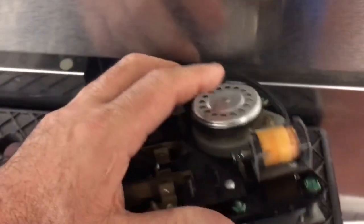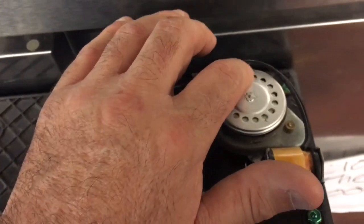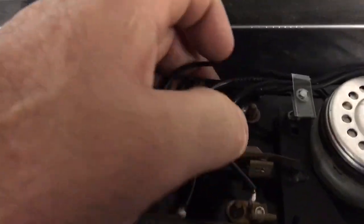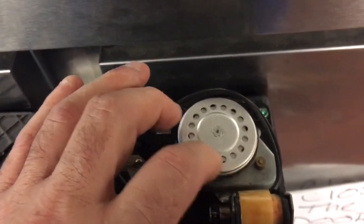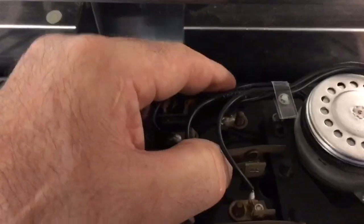When I plugged it in I got lucky — you can see this had a little cover. Always put these covers back on because the wires could hit the motor and stop it. Anyway, this clock started barely moving, and these things normally move really fast. If you see yours just barely moving, it's not going to keep correct time. This one would work for a few days and then it wouldn't — really hard to diagnose. When I turned on the box I saw it barely start up and heard a faint growling noise, kind of like a bad bearing.